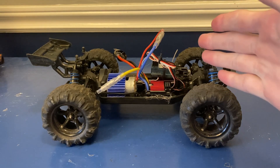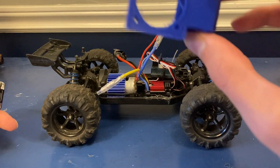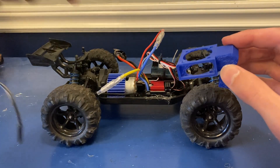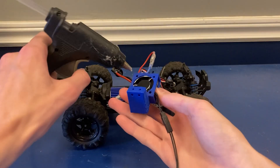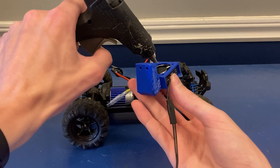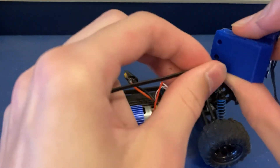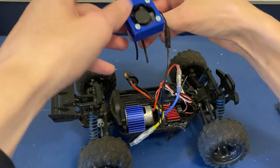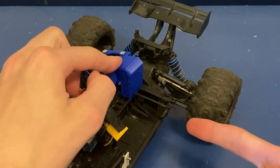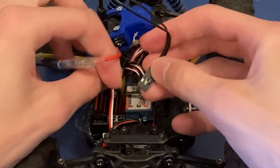All right so we're just about ready to get this thing running on 3S, although if we did that right now chances are the motor would overheat. So I'm gonna add this little fan here to keep it from doing that, and I'm gonna mount it in pretty much the same way as I did on the Sandyland — but with a slightly different mount because the fan is a different size and it's got to fit over the heat sink. We just slide in the fan and screw it in with a screw in each of the four corners, and I'll add a bit of hot glue in the back to hold them in. To put it on I'll use zip ties through the little holes, and to get power you just plug it into the receiver in one of the empty slots.